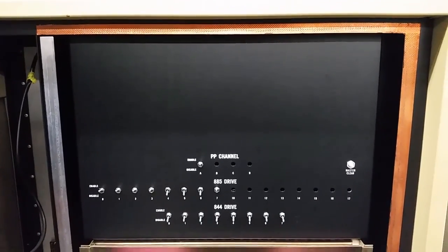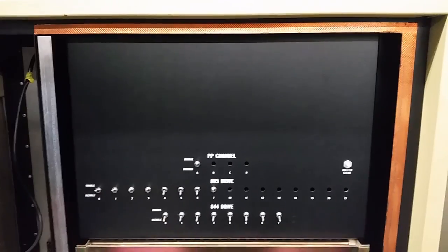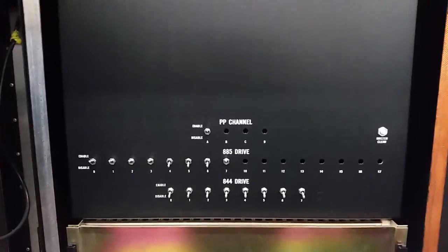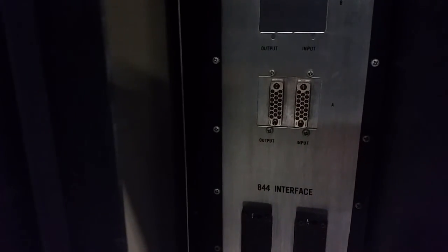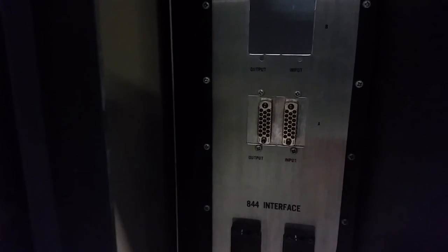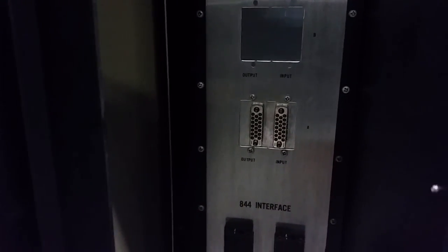CDC Cybers were a very different architecture from IBM 360/370 mainframes. The I/O structure was very different. CDC used a bunch of things called peripheral processors, and here we can see the PP channel. CDC had channels just like IBM's. Those are Cyber 170 channels — also Cyber 180 — they use the same type of channel. Unlike IBM's big clunky proprietary bus-and-tag connector, CDC used mil-spec Winchesters. Those connections are actually coax, and very high speed — like Control Data did everything high speed. The cables are much thinner too.